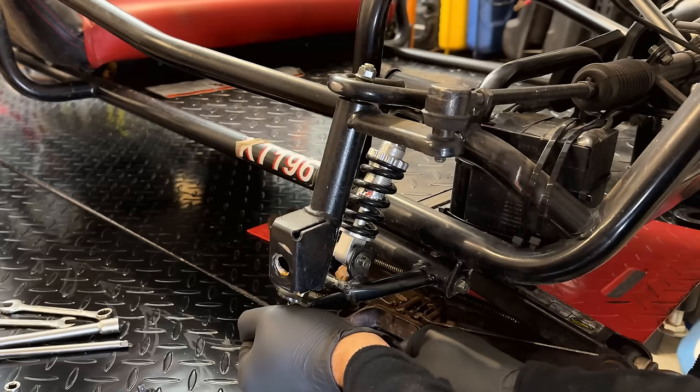So this is the airbox from the other engine. And I like it better, I guess, for two reasons. One, the build quality is better. It's thicker plastic. It's also more like a Honda OEM airbox. And if you look at the slot here for the choke, it is pretty wide, so I don't think we're going to have an issue. And you can see the difference when comparing it to this airbox. It's a very tight fit, which is fine if you're running the stock choke lever. But in this case, we do need the extra space.